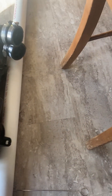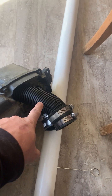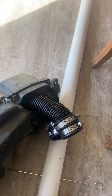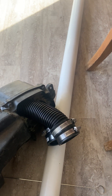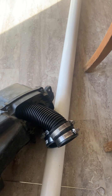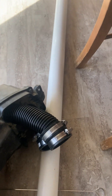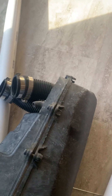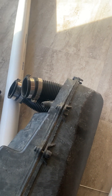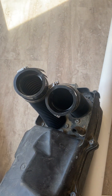Here is the factory air box. I want to make note — these factory tubes were gone. They had cut them up to make their snorkel, and the replacement I got didn't have them with it. At random, I was at the local Menards lumber yard and I saw shop vac hose and thought, hmm, I wonder. Guess what — shop vac hose works.